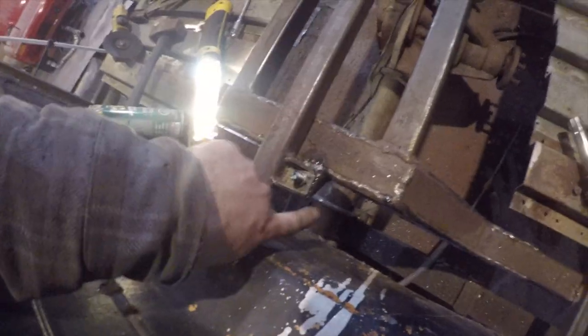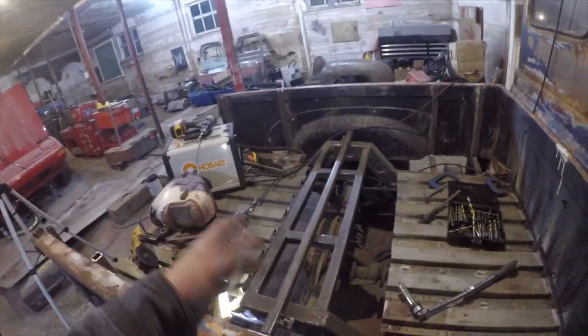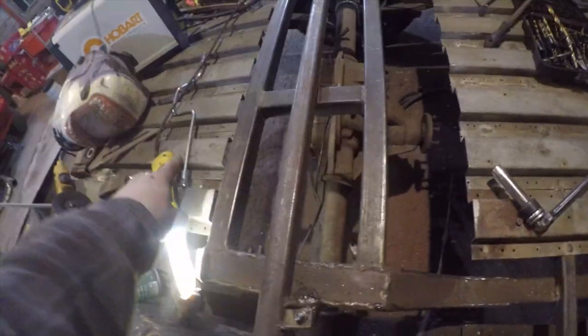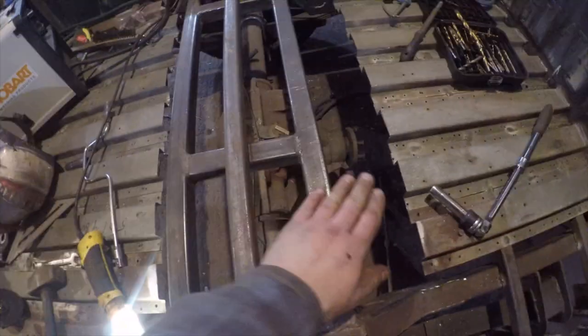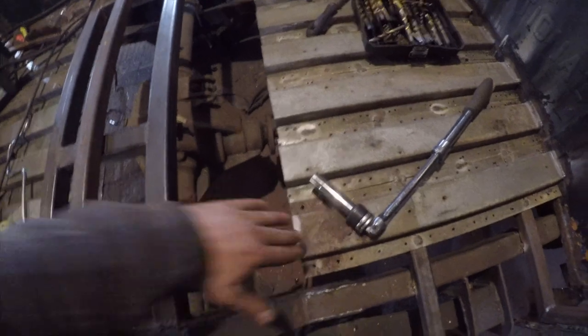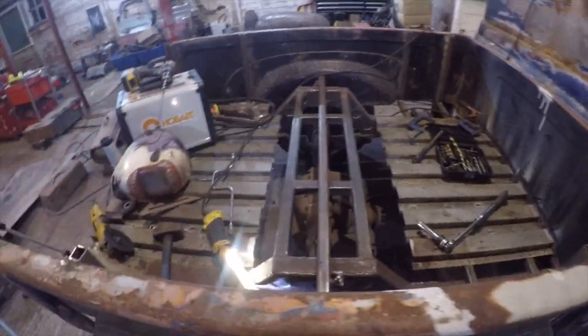We got the bed crossrail all bolted down. I ended up doing the captive nut on top — I welded the nut to it, so we can just put an impact on the bottom and zing them out. Small bolts, yes, but this is not a super serviceable bed. We're going to have eight total mounting points for this little tiny bed — it's going to be fine. Now we have a surface to mount our pieces to. Let me measure that up and start welding down, making sure they're all squared up.